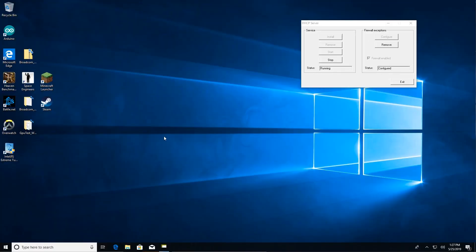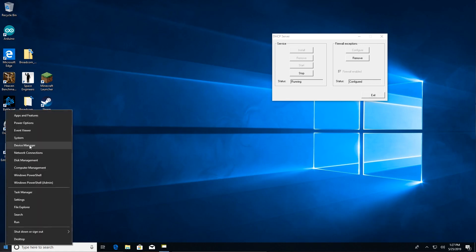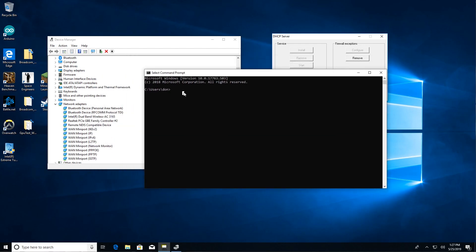That's really fast, especially if you're going to use Remote Desktop. I haven't tested it yet, but RemoteFX — if you're familiar with it — allows you to push your graphics card through the network interface. Now I have my Remote Desktop hooked up to the LattePanda through the cable. You have to run this DHCP server which you can download from the site. As you can see it's actually really smooth, transferring at 5 gigabits. If you go over to Device Manager on the LattePanda you'll notice the network adapter shows as a Remote NDIS Compatible Device. You can test the connection by pinging 1.1.1 and you can see it's hitting back.